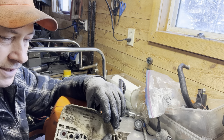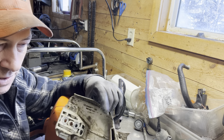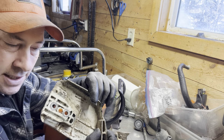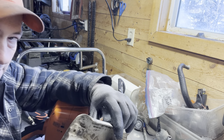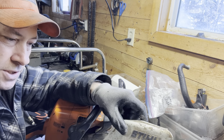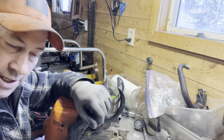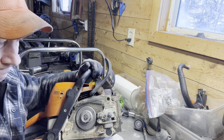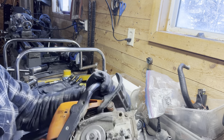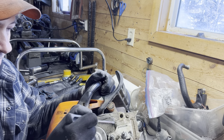Regular maintenance: you should be cleaning some of this debris out. Most saws actually have a rubber chip deflector here that absorbs the impact if the chain comes off — it won't chip the back of the clutch cover out. These ones are just plastic. A lot of the more commercial saws are going to be cast. Anyway, we're also going to want to clean a bunch of this stuff off.